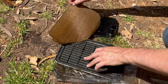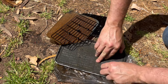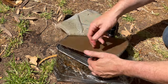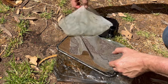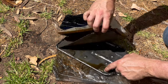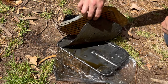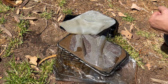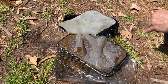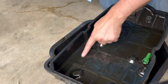Now that we've opened the filter, we can see that's just a little bit of dirt kicked up from outside. Looking at the material — the third layer of filtration is really clean, the second layer is really clean as well, and the first more coarse layer is absolutely clean too. The Mercedes triple-layer filter actually has a fourth layer of material as well. All of these are in remarkable condition — this filter has been on the vehicle for about two years and around 40,000 kilometres.